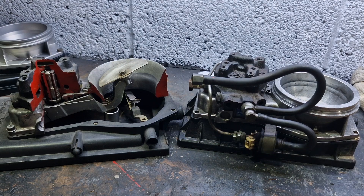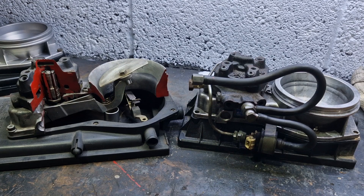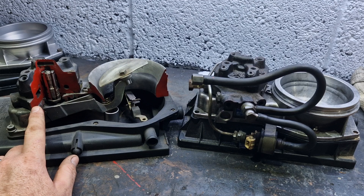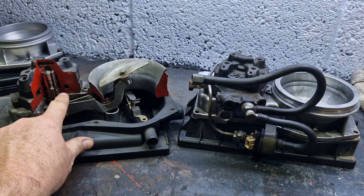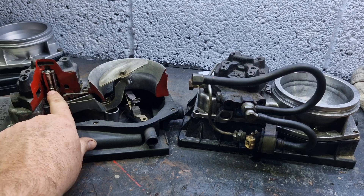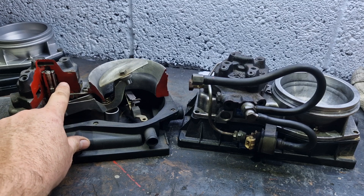So we've got more fuel coming out because the frequency valve has leaked off system pressure from the bottom. After a little while, the Lambda probe picks up that the air-fuel ratio is back where it needs to be, so it shuts the valve — no more system pressure leaking to tank. Pressure returns from 4.8 bar back up to 5 bar. The extra 0.2 bar back on the lower chamber does exactly the opposite: it prevents the diaphragm from deflecting as much, so the flow of fuel coming out starts to reduce.